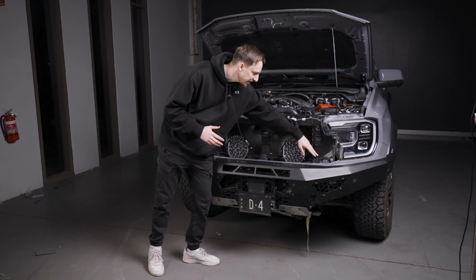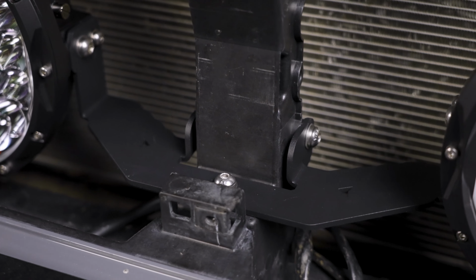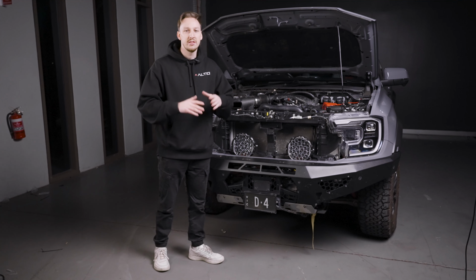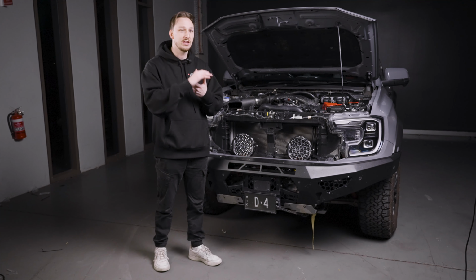Just to summarize, we're using the factory bolts and clips either side, only adding the 3 bolts in the center. The beauty is all of this is the exact same for the Ranger, Everest, and Raptor. The only thing that changes is the wire configuration. We've got wire configurations for level 1 and 3 headlights, as well as level 2 and the auxiliary kit. You can find the instructions for each one of those individually on our website or the link below.